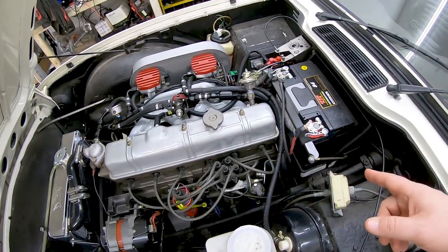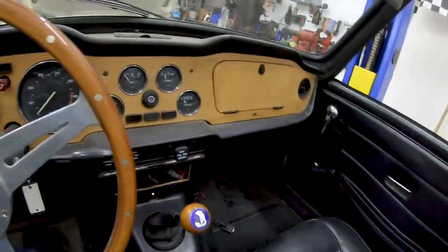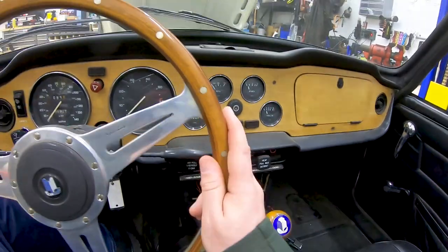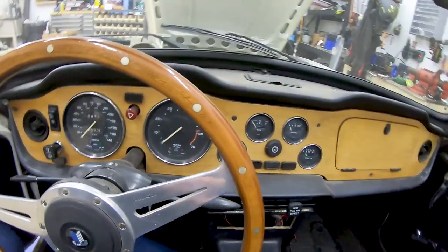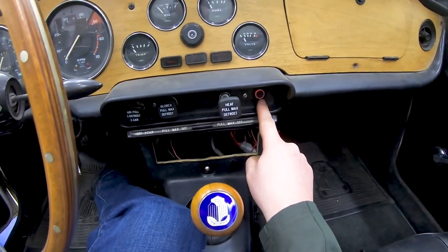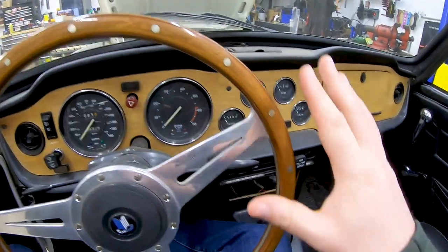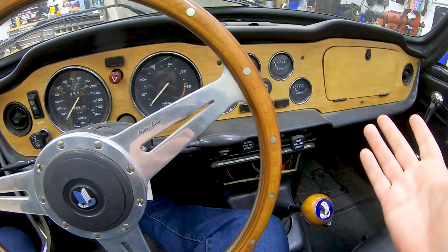I have the car currently configured so that the PMU-16 comes on as soon as you open the driver's side door. The PMU-16 and the ECU are located underneath the dash, and I wired that up in case you wanted to prime the fuel system when you open the door versus when the key comes on. From my experience with this car and this particular ECU setup, it doesn't seem to matter much. I also repurposed the spot where the choke had been to be an override for the electric fan, so if you want to turn on the electric fan before the thermostatic switch kicks in, you can do it with that button. I also set the electric fan to be controlled by the PMU to continue running for a set amount of time after the car is turned off, to let it cool down before shutting itself down.